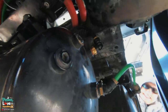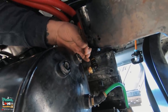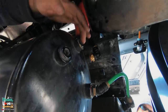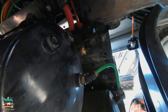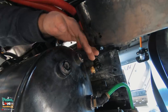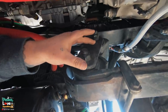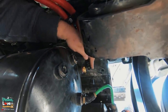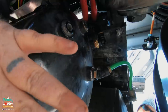Now that we got a little bit of quiet, hopefully you guys can see all of that. This right here was right here and it was getting hit by this leaf spring. We have corrected that - I pulled this plug out from over here, put it right there, moved this up there, and moved this one down here. That makes more sense - now it's away from the leaf spring and the leaf spring shouldn't hit it. Here's my shackles, so when you bounce down the road this gets pushed back, and it was banging right into that plastic piece.